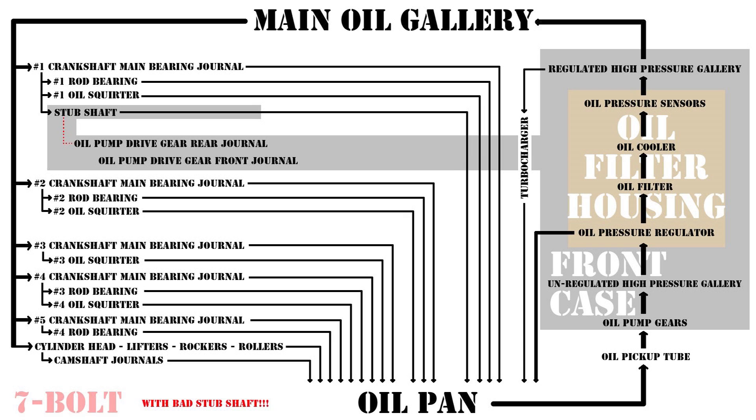When I installed my defective stub shaft, it essentially blocked off both oil pump shafts. This increased pressure on the number one oil squirter and rod bearing, and I lost an additional two oil drains. The stub shaft drain line should be a dotted red line as well — so I basically had four galleries blocked off. You could both see and feel the effects of oil starvation on the shaft and bearing surfaces of everything downstream from that stub shaft. The number one main bearing was fine, and based on these charts, now you see why. We'll talk about what happened to my rod bearings later because the variables that killed those will have little to do with oil flow.